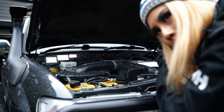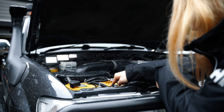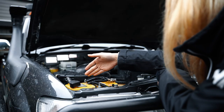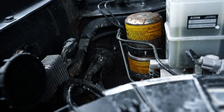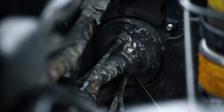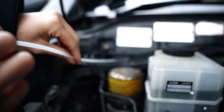This is the part I hate the most — wiring. The second battery is right on this side, so we're going to run the wire through the driver side towards it. We'll need to cross the wires through the firewall. Since the entry point is already quite tight, we pried it open a little more and used a lead. We taped the wires to a zip tie and then used the zip tie as a lead to get through the firewall.